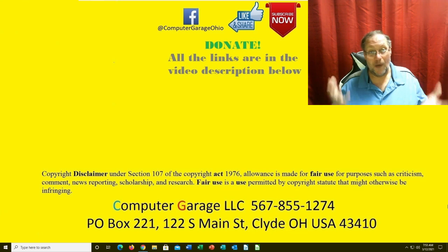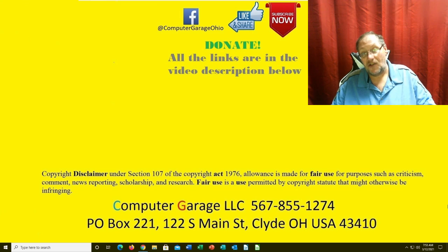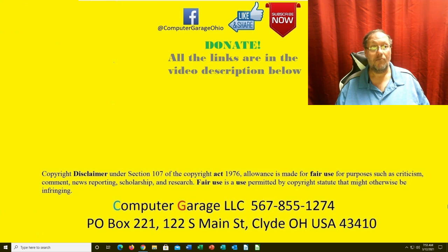With liquid damage: turn it off, hold that power button until it turns off, rip that power cord out, and let it sit. If you have an external battery, carefully slide it to the edge and pop the battery out if you can. Most modern laptops now have internal batteries, which I'm not a fan of, but the best thing you can do is just turn it off and let it sit for a day.